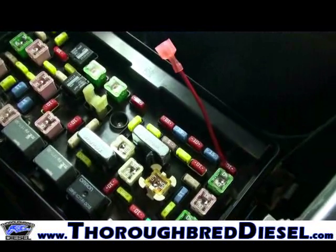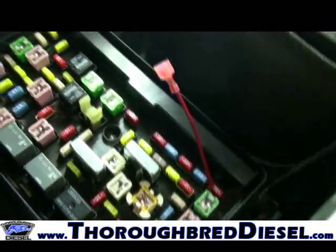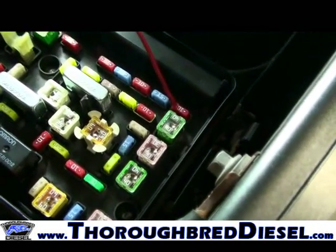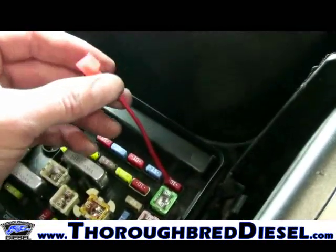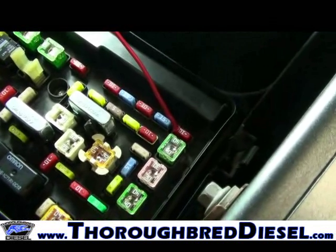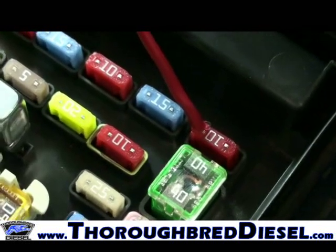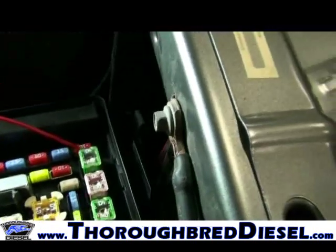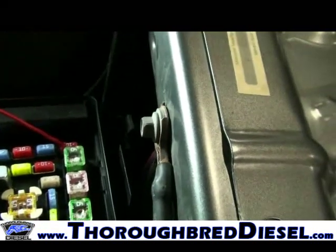Here on the 2010s, the fuse you're going to want to use is the M52 fuse. You can check the legend on the inside of your fuse panel box to find M52. When you use one of these jumper fuses — which comes with your Edge kit — you'll want to put the soldered wire side on the hot side of the fuse. Check it with a test light; it'll be towards the engine. Your ground will be conveniently located right on the fender well — it's a 10 metric bolt — and this all connects into your main wiring harness.